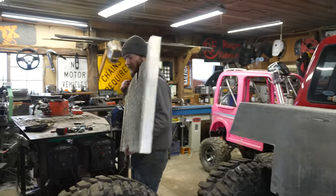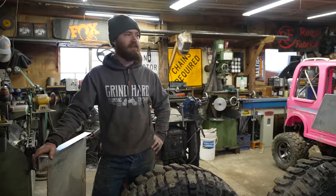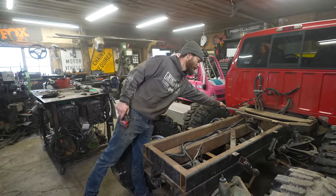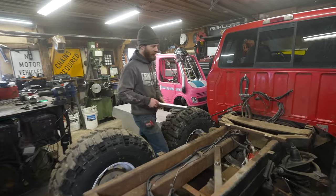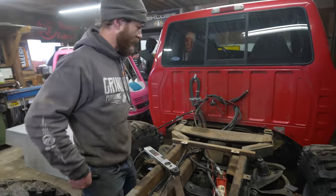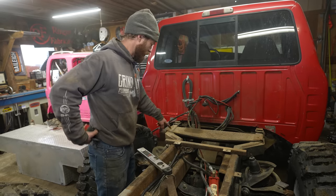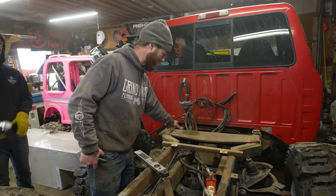I really want to know when it was built — it seemed like it was a while ago. But it's a 1995 Ford Ranger, it can't have happened when it was new. Before I can really build a whole flatbed on here, I just want to clean it up, make it a little prettier, get rid of all the stuff we don't need. Under the gas tank we found another ridiculously overkill thing — that's 7/16th solid plate all the way across there. There's also a square tube that goes across, so we'll probably cut that out and put in a couple of little gussets.